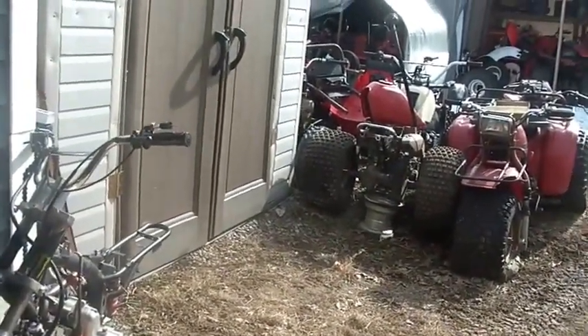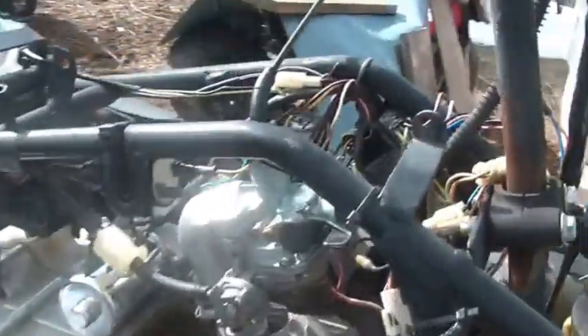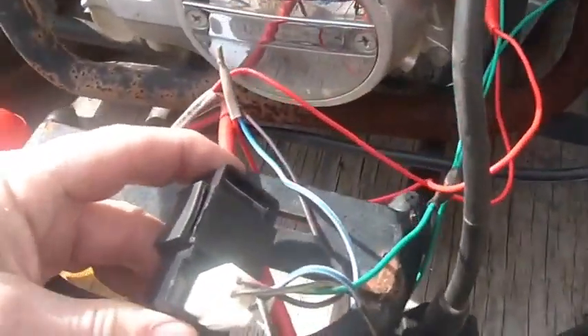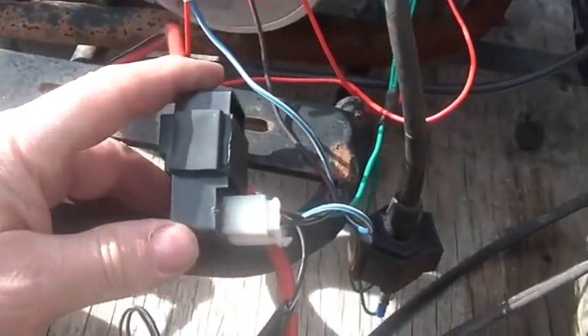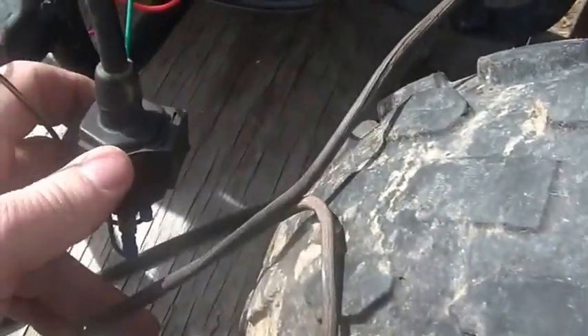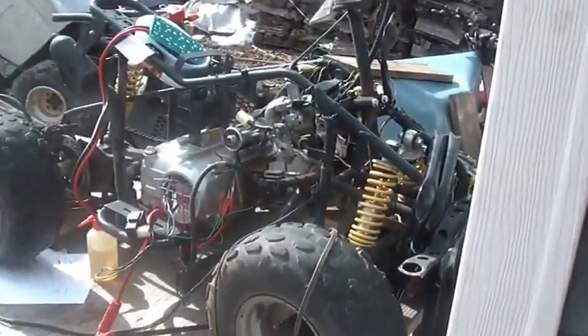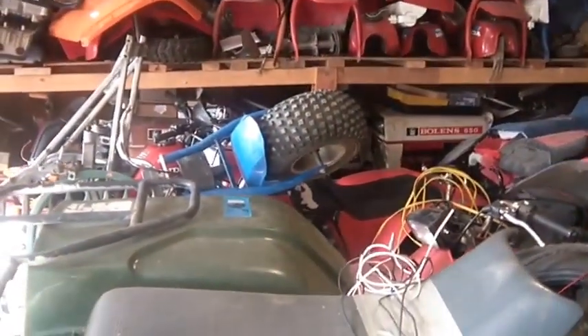I've not seen a bad pulsar yet. Most of the time what I see on these things is the wires all completely hacked up — somebody lost the key or something. I have seen a couple of CDI units go bad — on the China bikes and on the Hondas. I haven't seen a coil go bad yet; I imagine it happens but I haven't seen it. Mostly it's hacked wiring, and I've just given you a pathway around that. Anyway folks, thanks for watching, commenting, and subscribing. Remember to keep your feet down, keep your heads up, and please get out there and enjoy all your days. Bye now, folks.